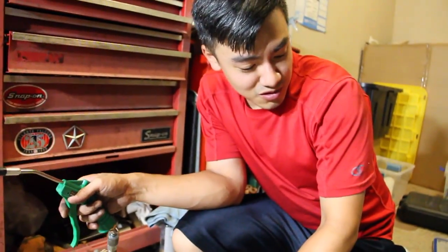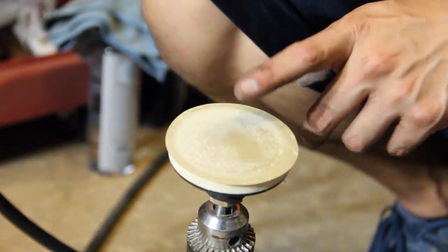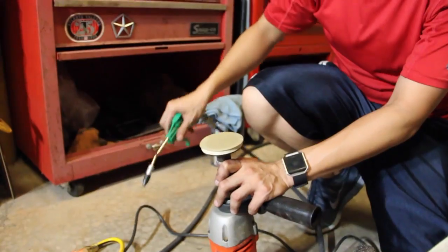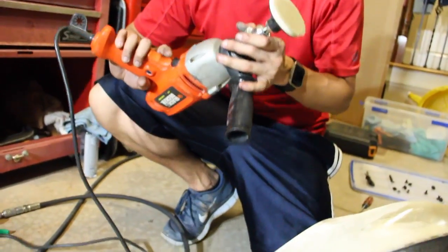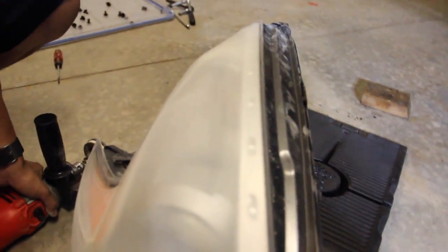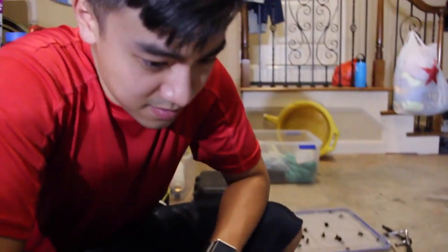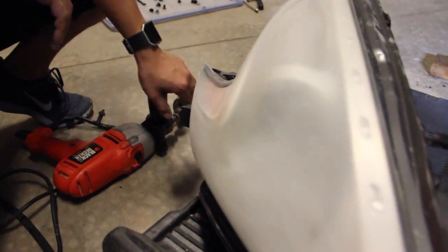So after you do this for a while, there's a buildup of oxidation and plastic on it, so to make the pads last a little longer, get a little air on them and you're good to go — you can keep making them last longer as opposed to changing them out every two minutes. Once you've sanded this down with the P500, what you're looking for is a smooth, even surface. Make sure there's no burrs on it — any burnt marks from sanding — and then move on to the wet sanding.